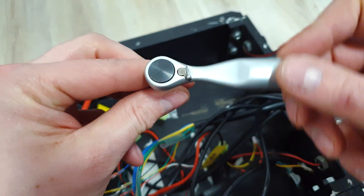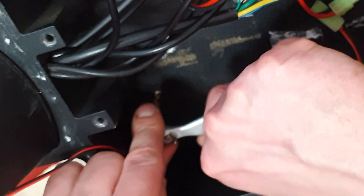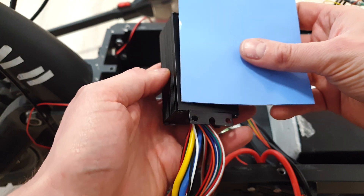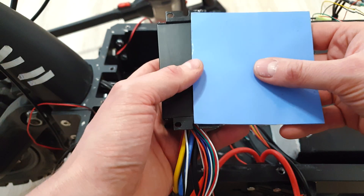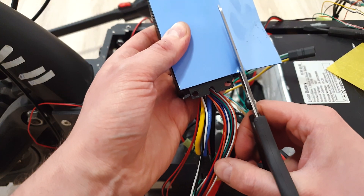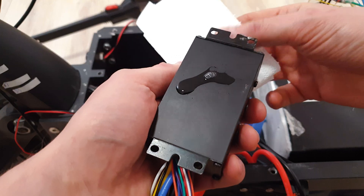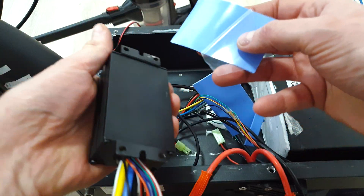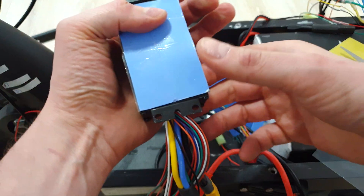It's quite easy to use this tool — all links in description. This is a standard quality thermal pad, not very efficient but it will still do the job. Thickness is around 2.5mm. It will be great for this 75-100 controller as you can see. I will have to cut off a small piece to be the same size as the flat surface on the controller. Use some alcohol to clean it, then peel one side of the thermal pad and place it on the controller.